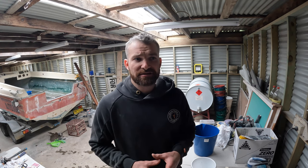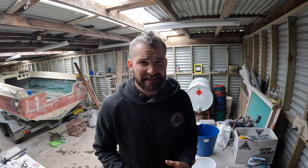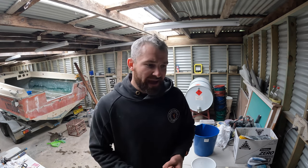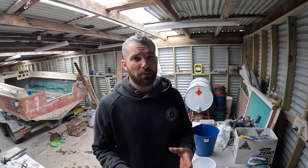Some people like to drill holes in their boat between the stringers and the voids to drain water out. Potentially water can get in there and potentially that's a good idea. The reasons I'm not doing that in this boat: first, we're using vinyl ester resin — it is waterproof. Second, we're gluing the floor down to this, sealing the compartment right up, and I don't intend to penetrate those compartments with any screw fittings or anything. So I personally can't see water getting in there and it will be glassed in really heavily. I am just doing this on what I believe is the best option available to me to suit my needs.